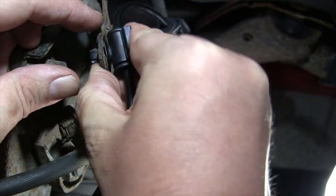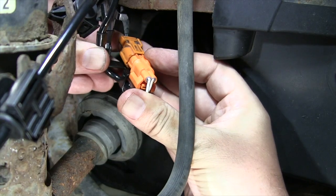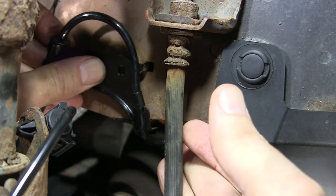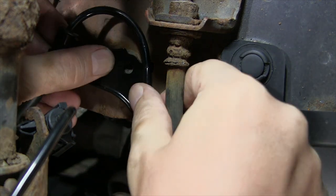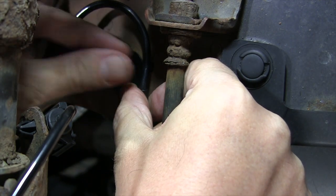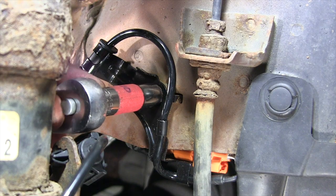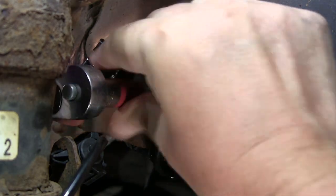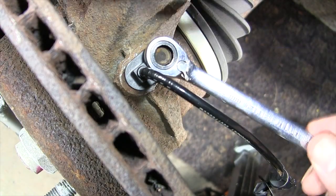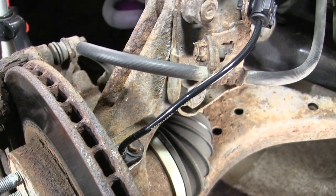I then routed the cable up past the suspension bracket and snapped in the new anchors. It was time to plug in the new cable to the body connector. The new metal bracket has a small finger that locates to the square hole in the body, and the orange connector actually sits behind the sheet metal flange. I started the 10 millimeter bolt by hand and then tightened it down with the socket. The ratcheting wrench did the same work at the hub — and there it was: the new wheel sensor and new cable installed.